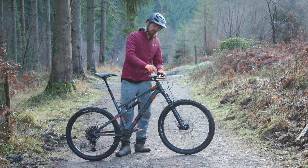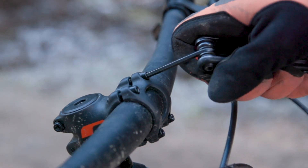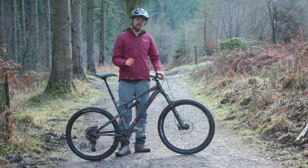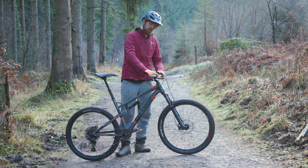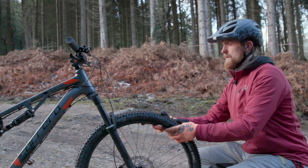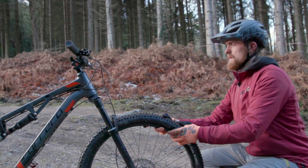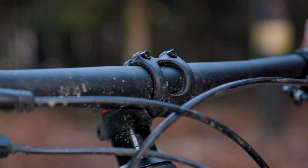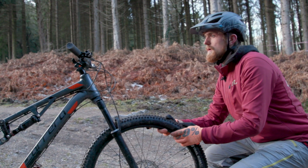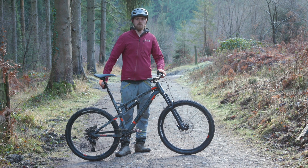To adjust your bar roll, just loosen two of the face plate bolts on your stem — either the top two or the bottom two — just enough so that you can roll the bar in the stem but not so loose that you might accidentally move it side to side. While you're doing this it's a good idea to check that your bar is perfectly central within the stem. Then roll your bar either up or down and retighten the face plate bolts and recheck how the bar roll is looking. Remember that like bar height, this is something you might want to come back to and adjust later on.